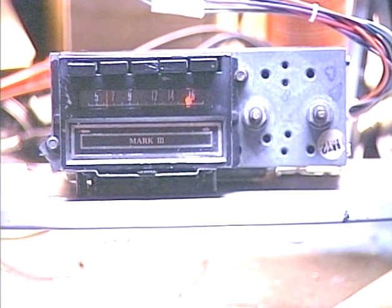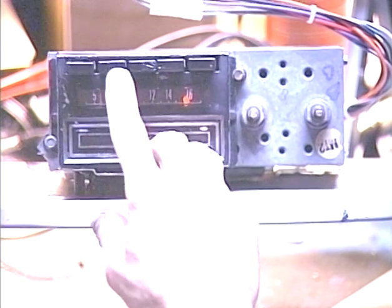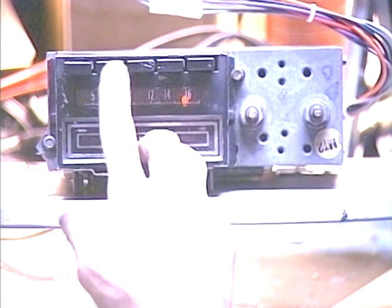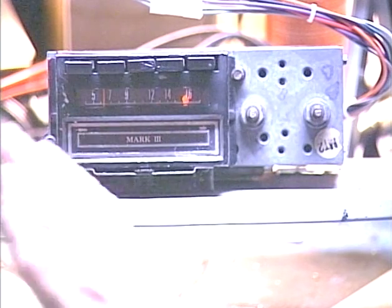It also has a more narrow locking range, meaning it might take a little practice. For instance, if you set a push button to a station, it depends on how hard you press it — if you don't press it hard enough it may not quite make it, or it may not return to that exact station. One neat thing: if two stations are very close together, you can actually use one push button for two stations depending on how hard you press it and the direction the pointer is coming from. That's a way to take advantage of the tuner's original characteristics.